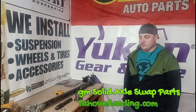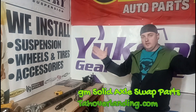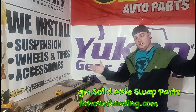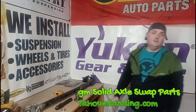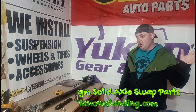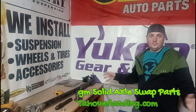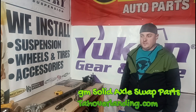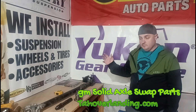My other Tahoe has been on the trail for close to three years now and still hasn't had a drive shaft failure, so this spare is still sitting unused. The key measurements are: how short it needs to be to get out of the yoke, how long it needs to be just past your fully extended length, and your U-joint style — 1310 U-joint, 1310 double cardan at the transfer case end. Tell that to a drive shaft shop and they'll build you one. You can also use online shops like Tom Woods or Adams Drive Shaft.